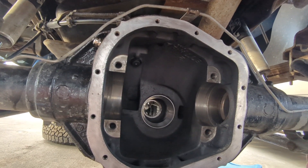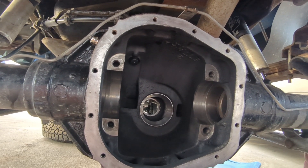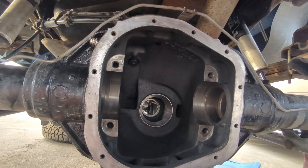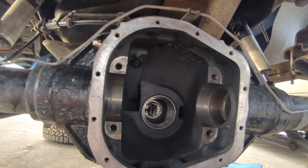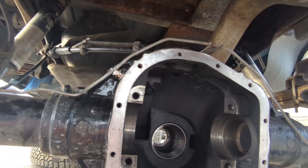The next day, I installed new Robustos e-brake cables because mine were getting to where they would stick a little bit. New Timken bearings, drove the races for the pinion in, and drilled and tapped the housing for a cable gland.